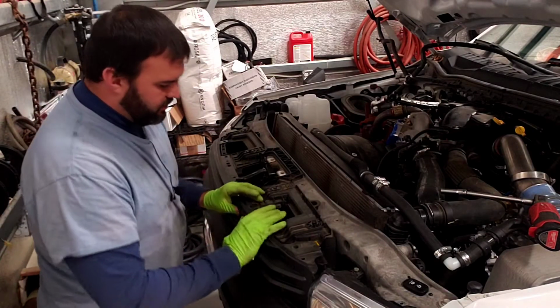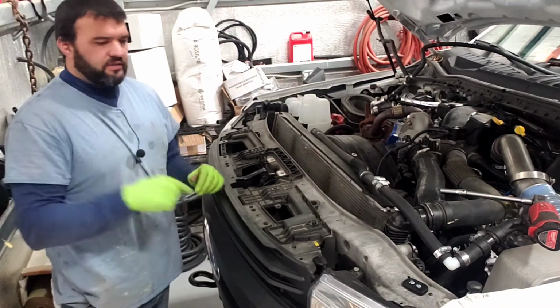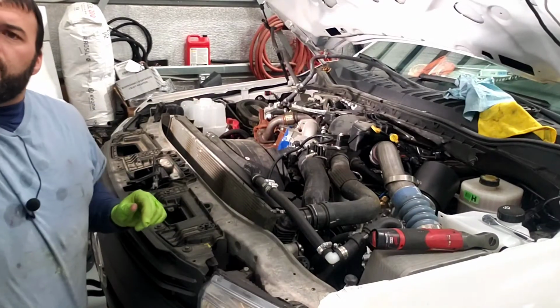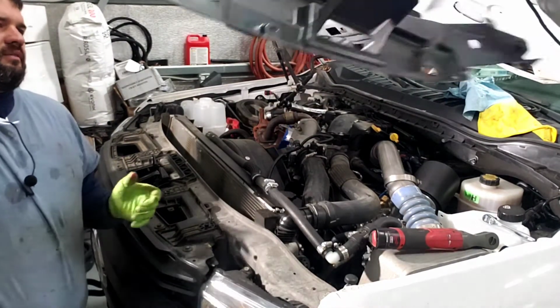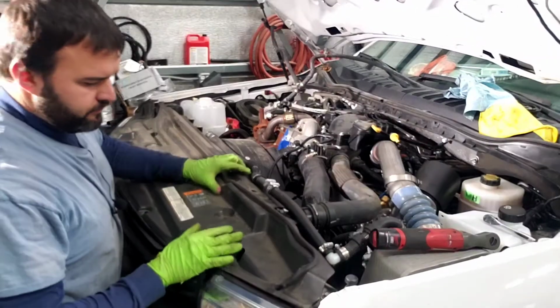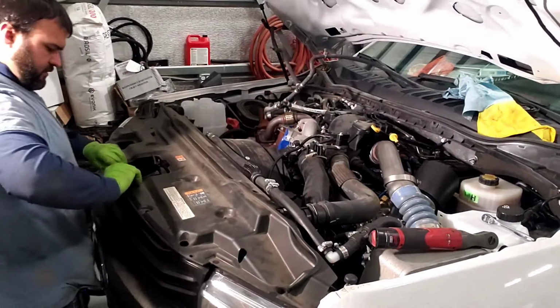Doesn't take a lot of pressure. Put your bolts in. Again, that's a 10mm. Tighten it up. You can move on to the bumper or the upper shroud, either way. Our grill is put in, torqued down. And now we're going to put in the upper radiator cover, shroud, whatever you want to call it. Make sure you have all your tools out from under it. I've been known to leave a wrench or something under there from time to time.